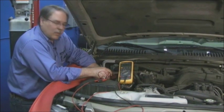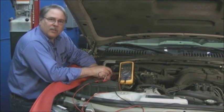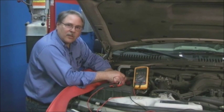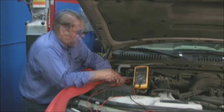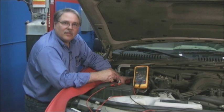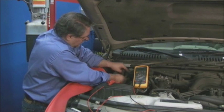The next check is good to know: all the speed sensors — the turbine shaft speed sensor, the input shaft speed sensor, and the output shaft speed sensor — they all share the same ground with the heated O2 sensors. In order to check the ground circuit, we have to plug the connector back in and back-probe it under load. We should be under 100 millivolts. We need to turn the key off before we plug that connector back in.